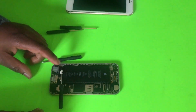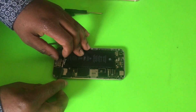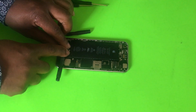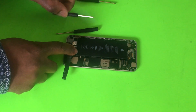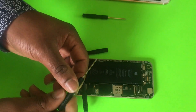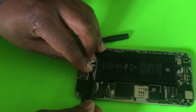Hey YouTube, today I'm going to be showing you how to remove the iPhone battery without using heat. If you look at the bottom of the battery after you have opened the iPhone, you're going to see two black little pieces of plastic right at the bottom of the battery. What you do is grab a screwdriver or a pen — anything that you can roll the tape with — and then press it right at the beginning of one of those black pieces of tape, or you can put it on both of them.